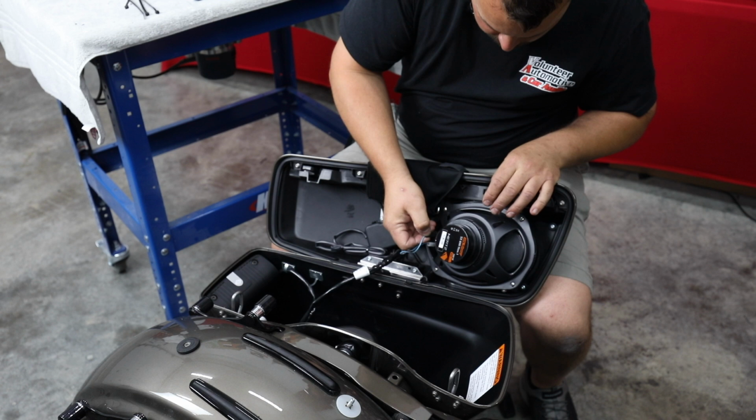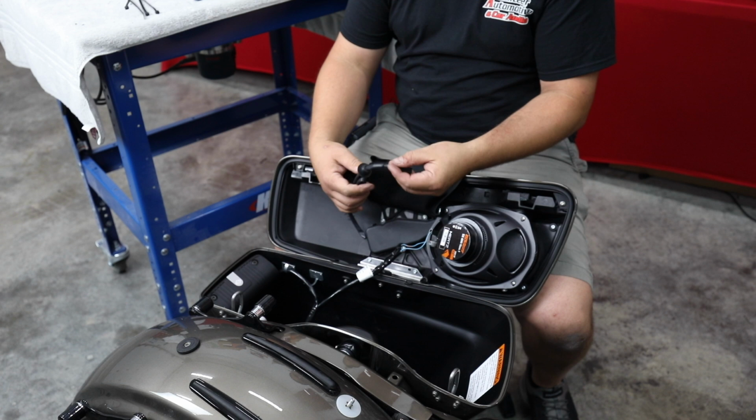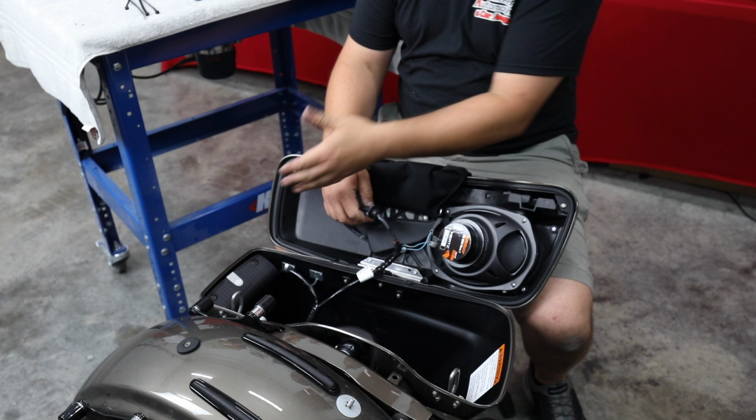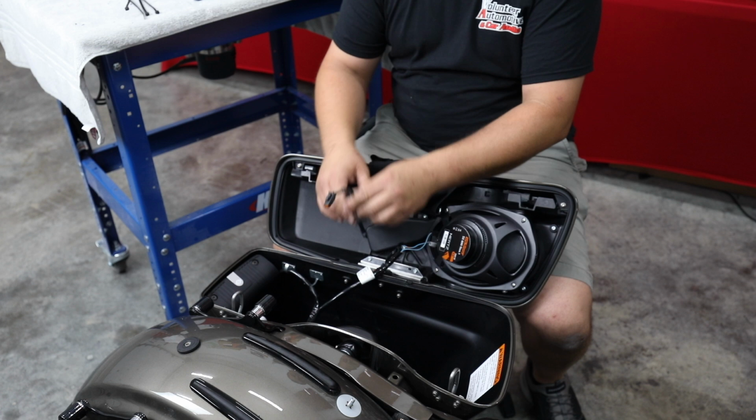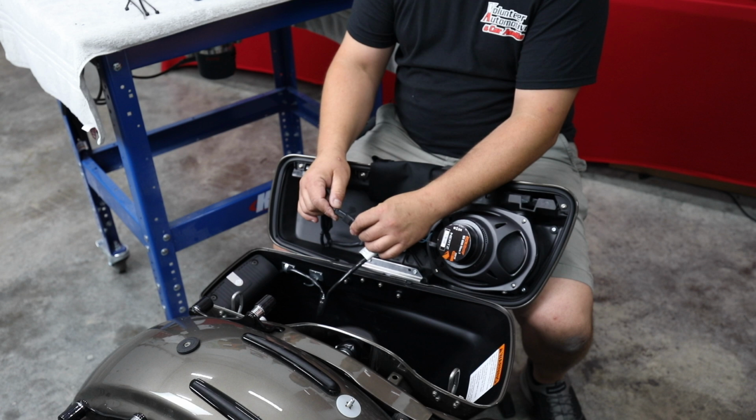So what appears to happen is this is the wiring that would normally be on a Boom One bike, or one that didn't have a bag speaker at all, or a bag amp at all. So this would normally have run over, it would have run down, it would come back up, and there would actually have been a hole drilled in here for this grommet, and it would have plugged in under the tour pack. For whatever reason, it looks like Harley just decided to use the same harnessing on both. So we've got a tremendous amount of extra wiring